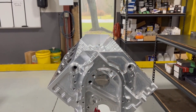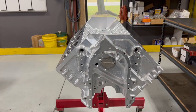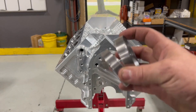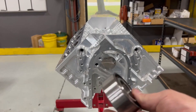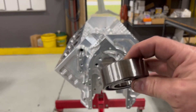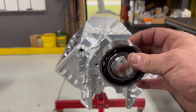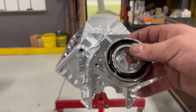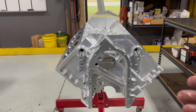This is a 65 millimeter core camshaft. It uses babbitt bearings — journals one through four — and then a rear cam bearing at the back. That rear cam bearing also sets camshaft thrust as part of the thrust process in the rear journal. As we get into installing the camshaft, I'll go over that with you. I'll put the cam bearings in, do the oil galley plugs, and start the assembly.